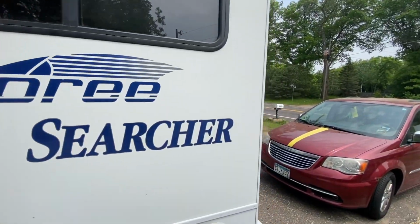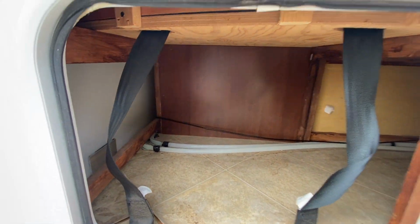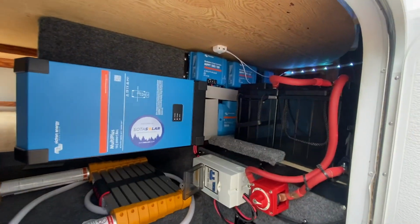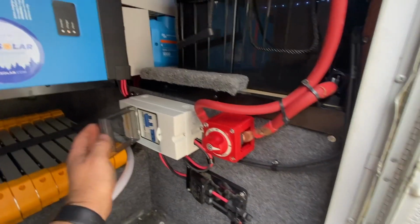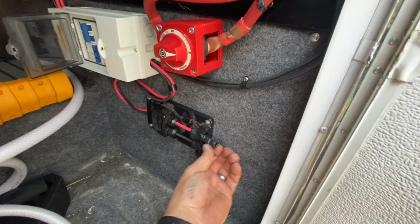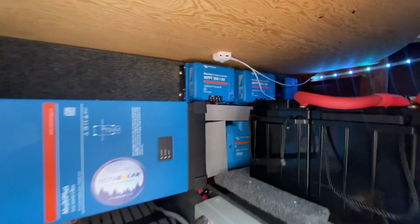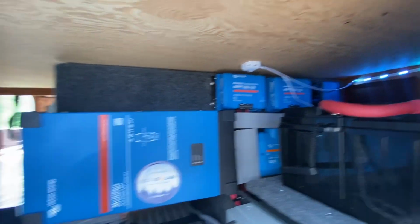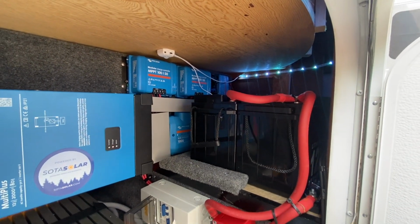All right, let's go take a look around where we ended up installing everything. There's a ton of room all over in here, but I think we showed this earlier, we ended up putting it all in here. This came out pretty well. We got breakers here for the roof and the ground mount. This is the ground mount ports I gave them. You can just plug right into that with the ground panels. And both charge controllers. And then the LED lights there that are motion controlled. So that's a nice little addition. Before, whenever we do the lights in there, they would be on all the time.